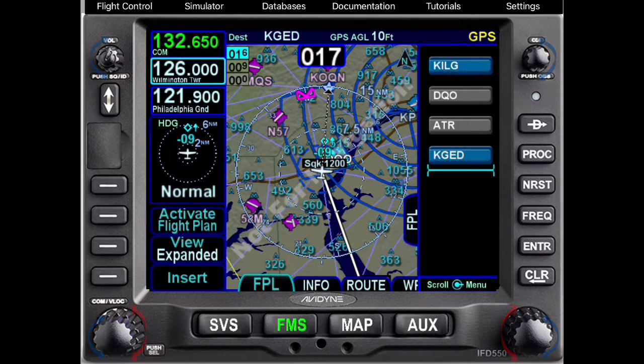I had actually reported that as a technical problem, thinking from my Garmin experience that I wasn't receiving satellite signals and couldn't enter a flight plan until that turned green. Lesson learned. Continuing, the comm section now has a secondary comm instead of always showing the nav frequencies. That's a data block choice. I'll show you how to do that momentarily. I really like this. Press the lower left knob to display the nav frequencies.